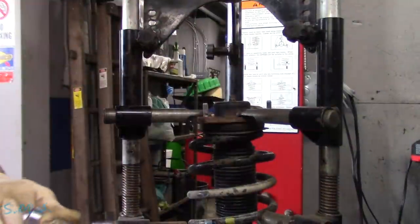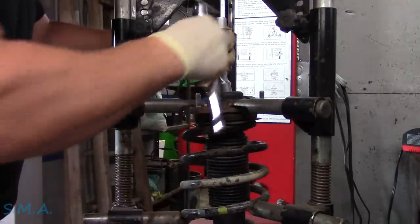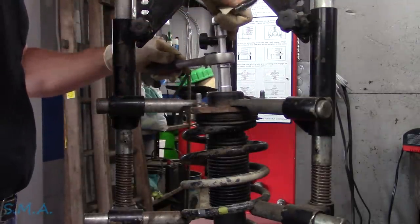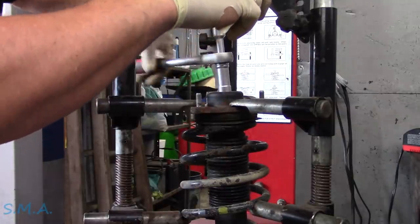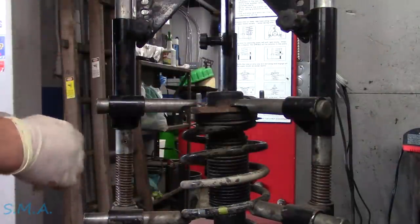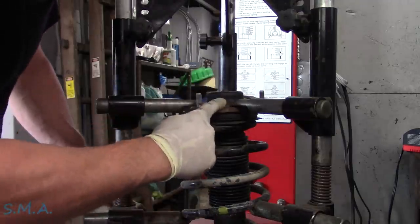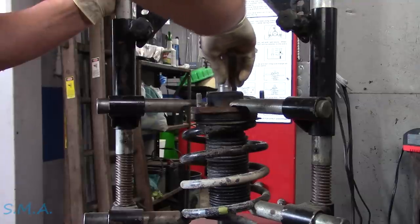At this point you're going to want to take your strut to a shop if you don't have a spring compressor at home and have them swap out the parts for you. We're going to do it here on the Branick — let's try this side, that one fits. We need to hold the stud on the strut and figure out which way to turn it. I've already got this compressed. Now, make some mental notes if you're doing this yourself using the old death-trap spring compressors — mark which way things are oriented: which way the spring faces, which way the strut faces, which way the upper mount faces. Use a paint marker if you have to.